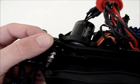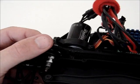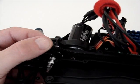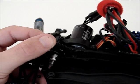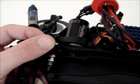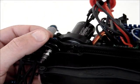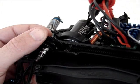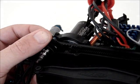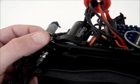And there's no real solution for that except to get long shank pinions and Dremel down where the belt touches. Now the most bizarre thing is, if you search the internet for this issue, you'll find that Team Associated claim that under power, under load, this doesn't touch, which is quite ridiculous. I mean, you can see the bend there. The pinion is acting like an extra tensioner. There is very good contact.